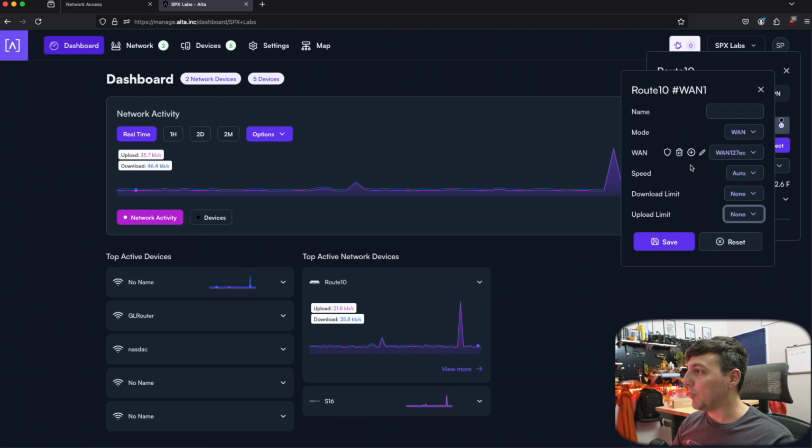Let's take a look at power consumption. Power consumption wise, this thing uses very little power when hardly anything is plugged into it. It idles around 6.6 watts. I've had the device running for about 26 hours now in some change, and we can see that it has barely consumed any power at all, giving an estimated cost of only 1 cent, or $5.78 for the entire year. So at the way we're running it, it's not going to use that much electricity at all. That's good to see.